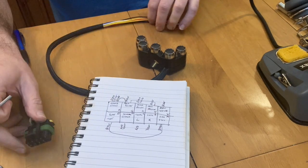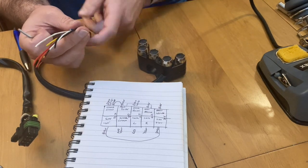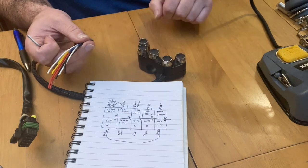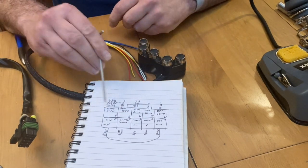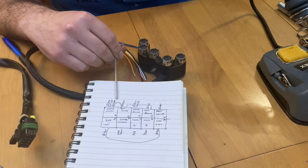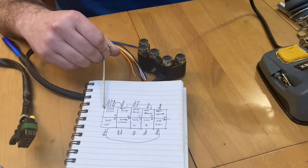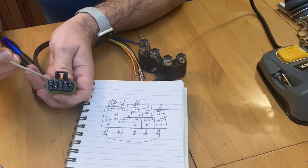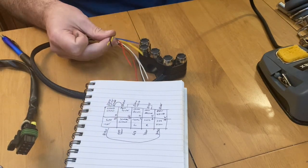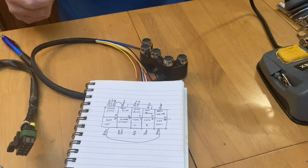Now this would have been rather easy normally, except for each one of these switches on my new setup is a pair. So I'm gonna have to solder these common connections across so that I can have the common for the indicators and a common for the lights, because I'm actually going to be doing a join here. So my side lights are always on. And my main lights are always on. So that's gonna be what these little two bridge lines are all about. Which means I'm gonna have three wires going into this point here. Now we don't wanna have three wires doing that. So I need to make some soldering joins within my main switch body here, so I only have, at worst, two wires going into here because one's a simple join. So that's what I've been doing now, and we're going to get started.